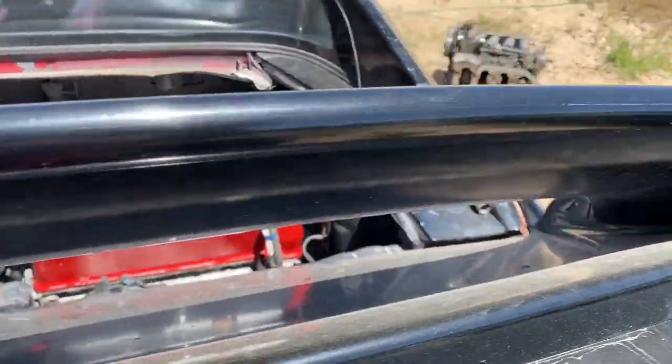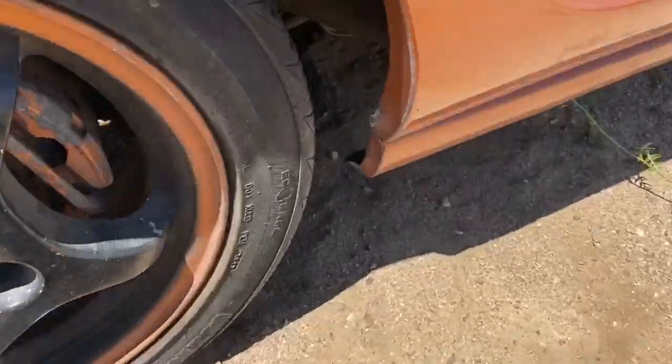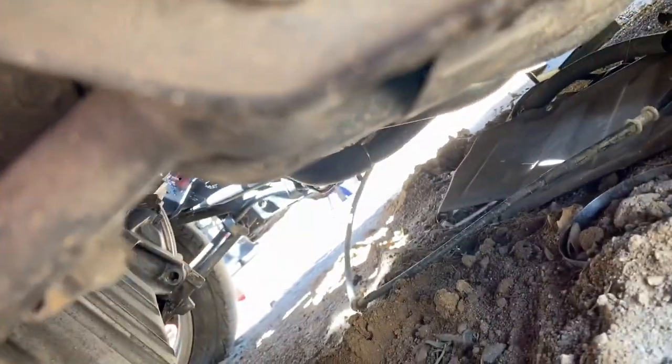The bottom hose, let's see if I can see it down here, but I basically chopped the hose right around here, and then use the stock factory hose and just run it straight. So you can just chop it right around here and then use the factory hose, and it goes straight to the thermostat with no problems.